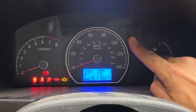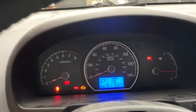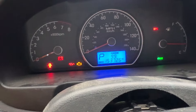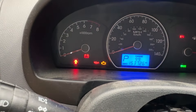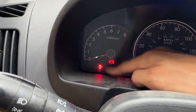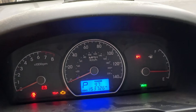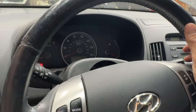You'll notice green lights are giving you information — like if I turn on cruise control, it's just telling you your cruise is on. Yellow is telling you, hey, watch out for this, this could be serious. Red is telling you, freaking pull over — this can kill you. So your alternator goes, if your door's open you can fall out, your oil pressure's gone, your brakes are bad. EPS is a red one — that's like your power steering has failed. You can still manually drive it, but that's really serious. Mine was flashing.